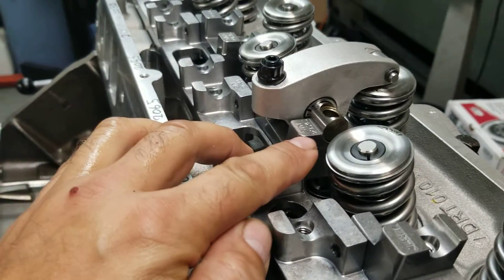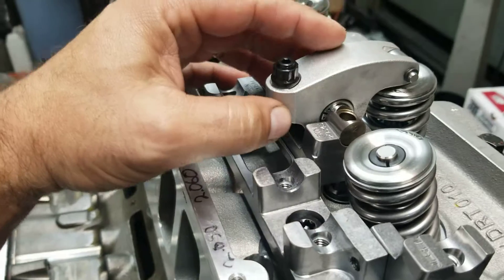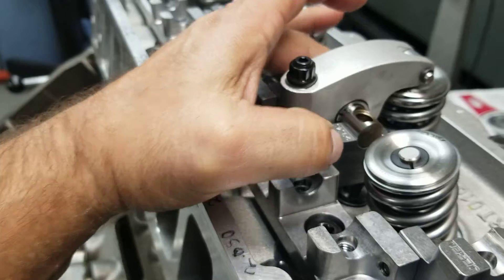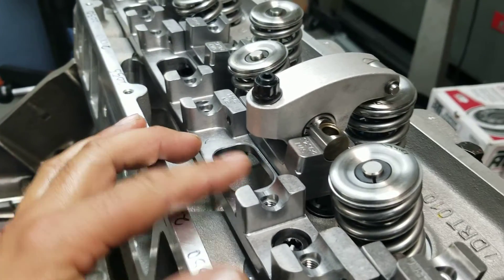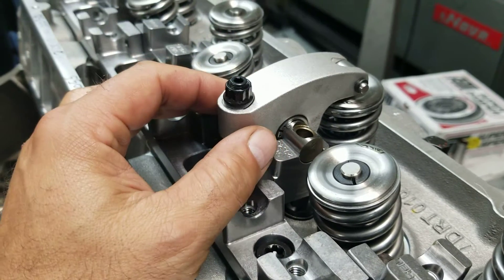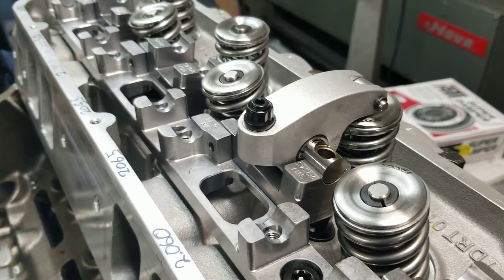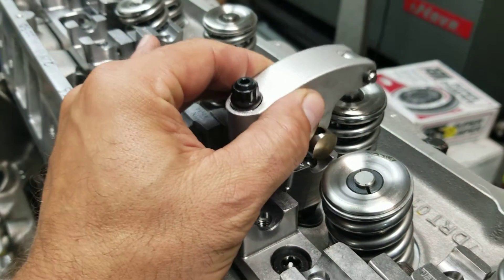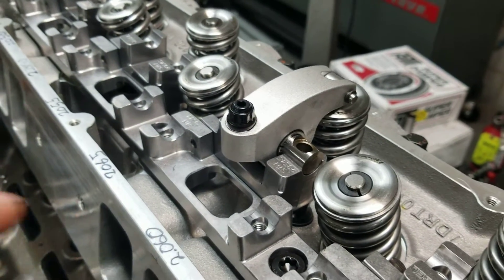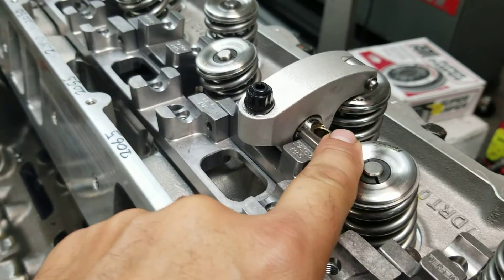What's going on here is that, unlike a stud mounted rocker where you have the weight bearing down from the weight of the rocker arm down on the valve, on the spring and the push rod, here you have a stand physically holding it up. Rocker arm weight anywhere between 160, maybe 180 grams. So they're sizable in weight, there's no doubt about it. You can take a lot of weight off your valve springs and increase the longevity significantly.